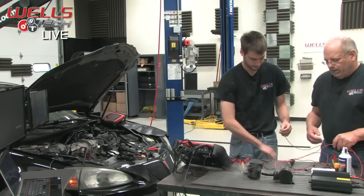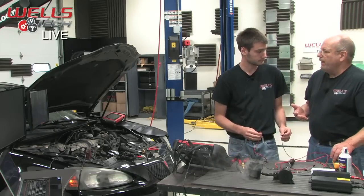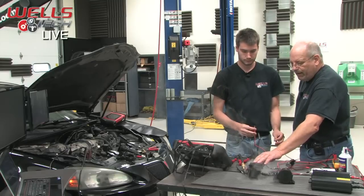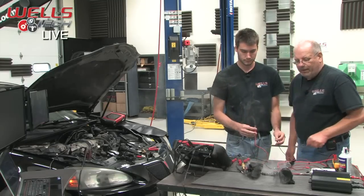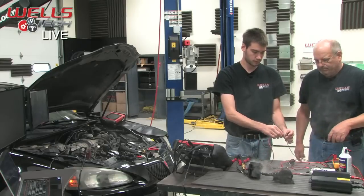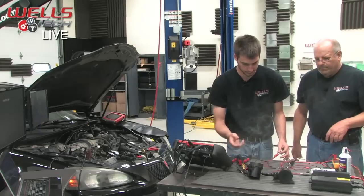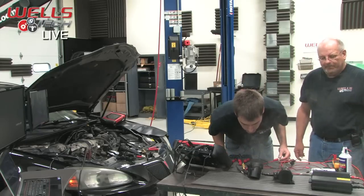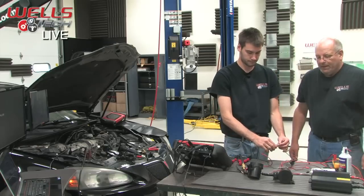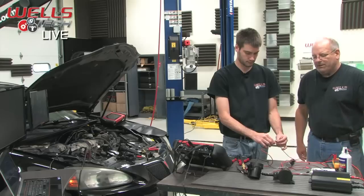Let's say you have a customer that complains about not being able to fill their tank. Sure. Okay, this is what's happening when they fill their tank, the air is coming out through that vent. Right. All right, so I'm going to power this thing up now. You'll hear a click, and immediately it stops smoking out of there, just a little bit of residual. And there's no smoke escaping at all. Right. So there's really no crack or problem with that to cause it to leak.